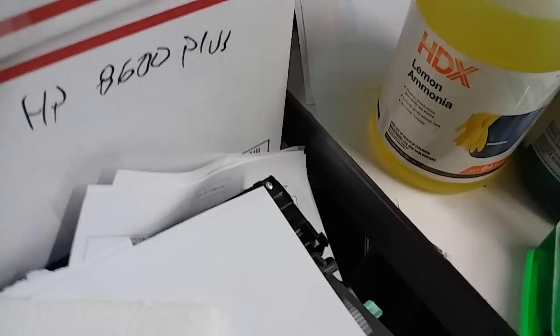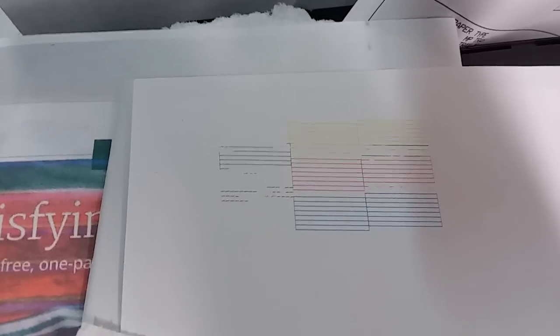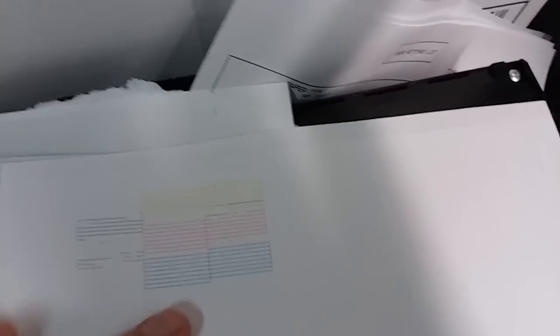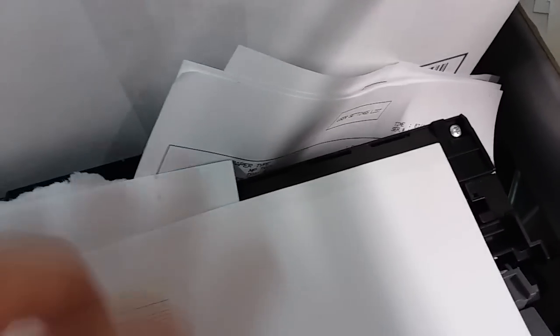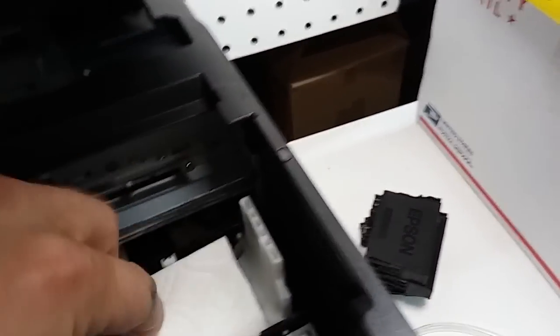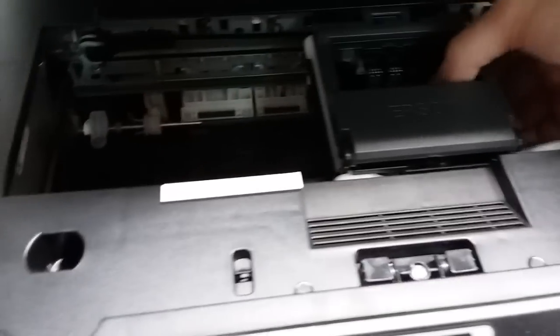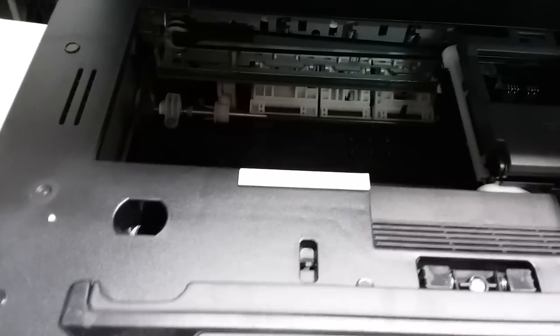Take a piece of paper towel and fold it to approximately the width of the print head — about one and a half inches should do, slightly more narrow than what's shown on the test page. Close the slot, slide the print head to the side, and place the paper towel underneath it. It's a bit tricky one-handed, but best to press gently, lift the carriage slightly without damaging it, and make sure it's positioned over the paper towel.